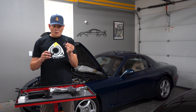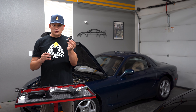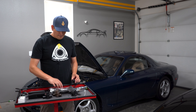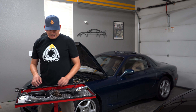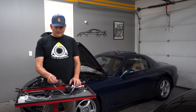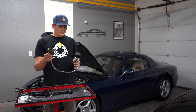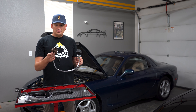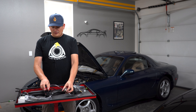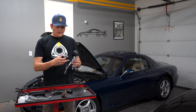I ordered a new hose, and since this is close to the turbos I wanted to check the valve itself. You can check the CRV and ABV using a vacuum tester — I used the Mighty Vac here. Connect a hose to it, apply a little vacuum, and you can hear it open and close. You can do the same with the blow-off valve: add some vacuum, hear it actuate, let it go — and it's good.